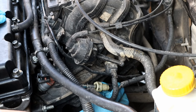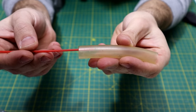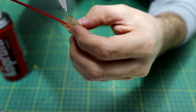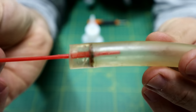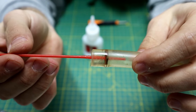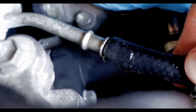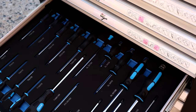Next, disconnect the fuel line. Now we need an adapter. It's very easy to make. Just find the hose that fits on your car's fuel rail, glued to a carb cleaner straw that comes with them. And that's it. Use a hose clamp to secure it because the carb cleaner can pressure will push it out.